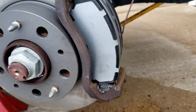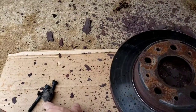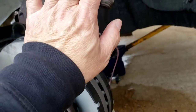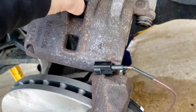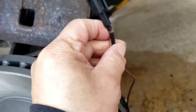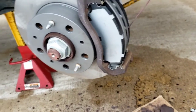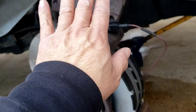To remove this, you need a 6mm hex. The 6mm hex takes the two bolts out of the caliper. Once you take it out of the caliper, you take the caliper and put it out of the way. If your wire didn't break yet, check this out — there's a little wire in here. It's a pad sensor like the Mercedes and BMWs have, because I think this van was made by Mercedes at that time. This one is broken, that's why it's just hanging there.